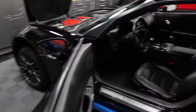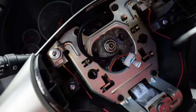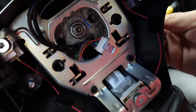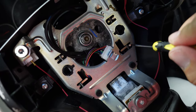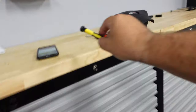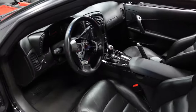Alrighty, airbag is out. Let me show you what you're trying to do. When you stick your screwdriver in the side hole here, you are trying to move these pins — you can see that this moves and then it unlatches these little hooks right here. Anyways, let's remove the steering wheel and see what we're working with.